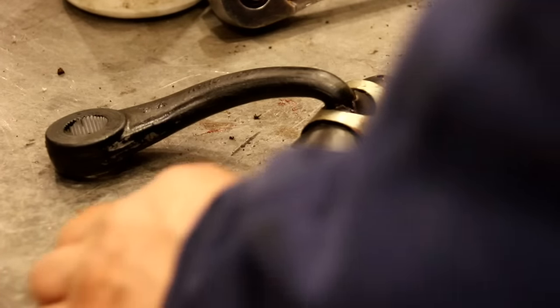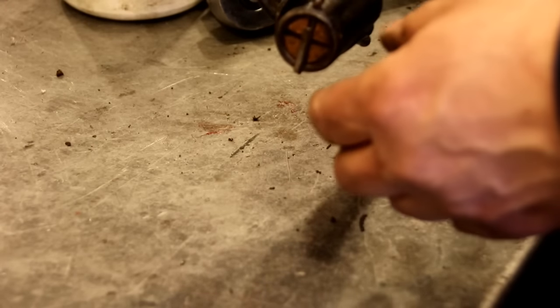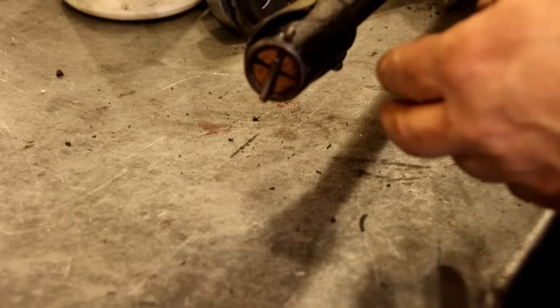There's not a whole lot of science to adjusting these — you just don't want to over-tighten them. You still want your pitman arm moving freely but with no play back and forth. I like to screw the screw in until I can get the cotter pin through it easily — just when it's deep enough to get the cotter pin through, I go two more notches, tighten it two more notches, send the pin through, and that's it. If it's too loose the cotter pin's not going through; if you go too deep you're just going to bind it up tight.